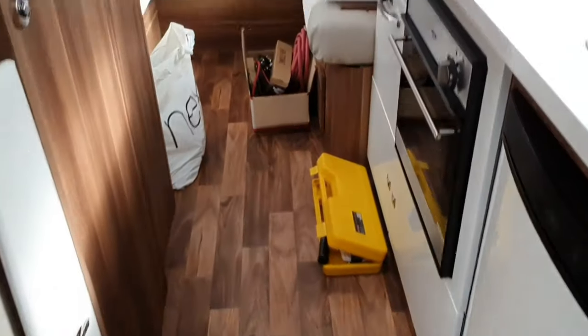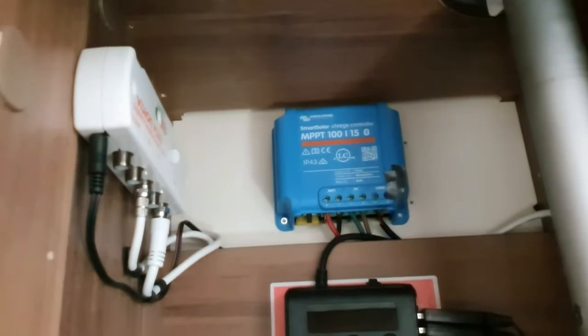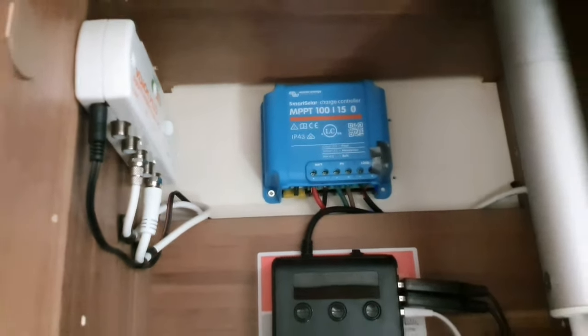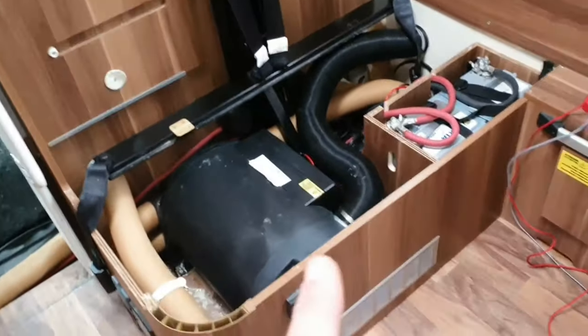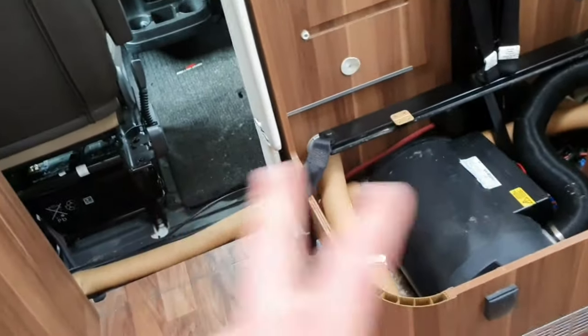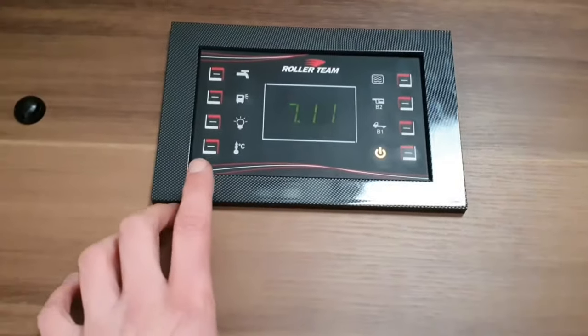Last night I was able to turn the inverter on. While I've been working today — it's now lunchtime — there's a 130 watt solar panel on the roof and it connects into an MPPT solar controller, which has wires that run down into the battery to charge it up. Now that I've changed the wiring, it's the first time it'll charge both batteries properly at the same time, treating them as one circuit. I can turn this on — yeah, it still works. That's good news.